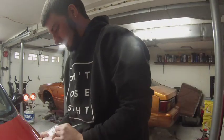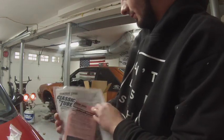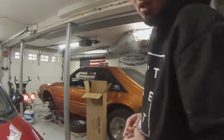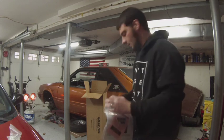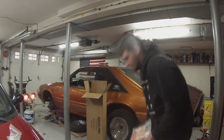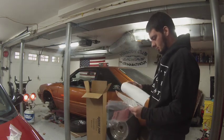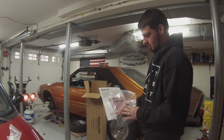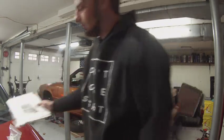I don't know if this is instructions or just a sales flyer — doubt it's instructions since it's pretty self-explanatory. The longer one that I held up will be our passenger side, and then the shorter one here will be our driver's side. And like I said, those are master cylinder to proportioning valve. Yeah, not instructions — it's just a sticker — and it says where to undo for the shipping bend and how to undo it so you don't ruin the line.